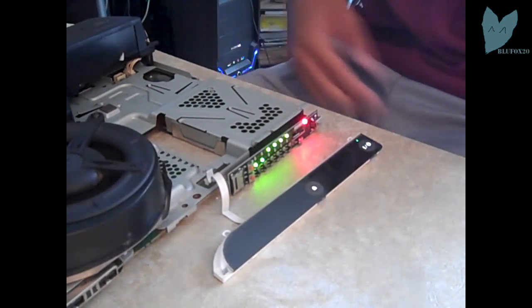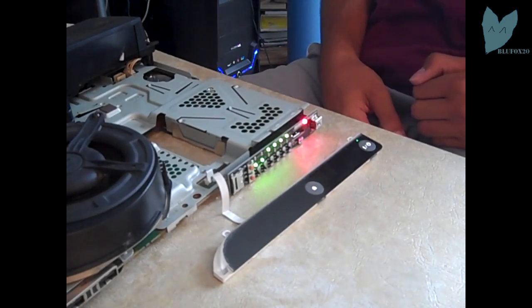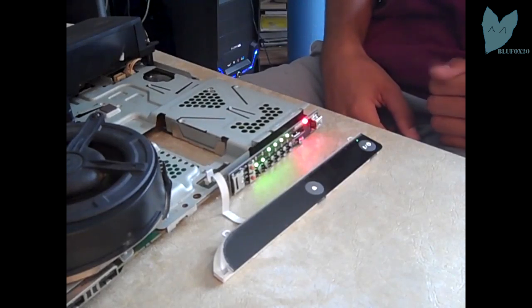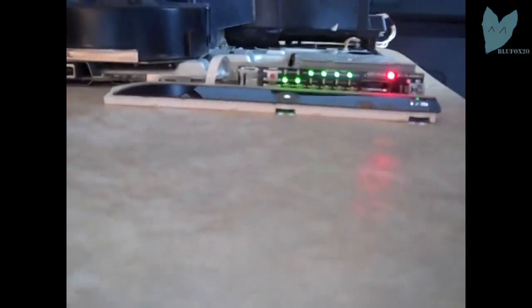And you're going to want to wait for TV signal to reach through. That's what I'm waiting for right now. Then I'll show you it. And the PS3 is not going to boot up completely since you don't have your hard drive in. But that's okay, you don't need your hard drive. Here's the error you get. Cannot start. The appropriate system storage was not found because it's on the floor. So here I'm showing you switches 1 and 2 down, rest up.